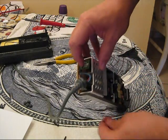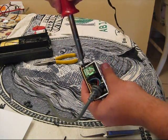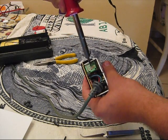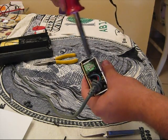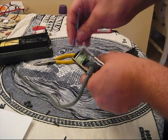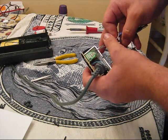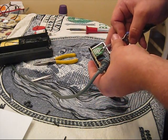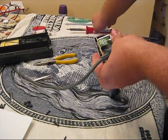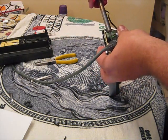So we're going to start by floating off this SMD. Get the soldering iron, put a little dab of solder on there — you know the process — just touch it repeatedly until it floats off. Take it off, get the other pair of tweezers, and pull it off after it's been floated off. Then you get your other SMD, put it on there real nice and gentle, and hold it there — it's really hard to do with the camera, but hold it there. Then you just tack the first side.